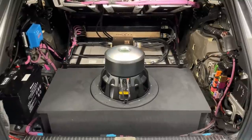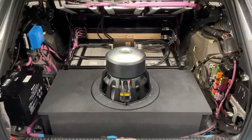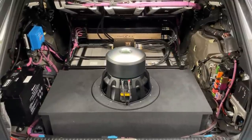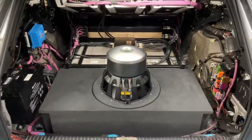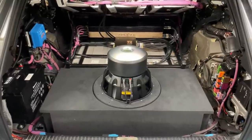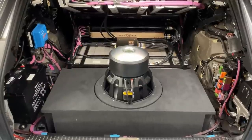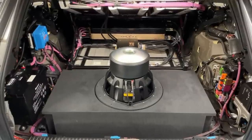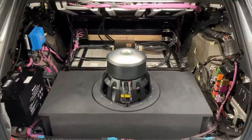away from us. So that's pretty much it for the speaker installation, other than, yes, we fitted speakers at the rear doors as well, running semi-active. 4-inch plug-and-play upgrade from Blam, and the tweeter is from the same brand, but the tweeters are separate. They are not from that two-way set. We put caps on the tweeters so they will run semi-active.